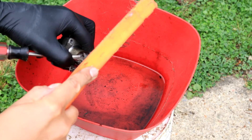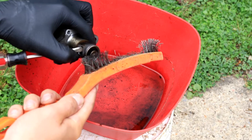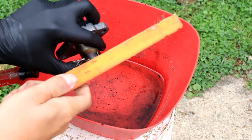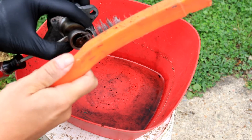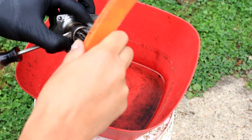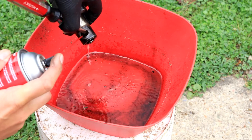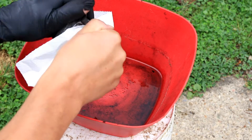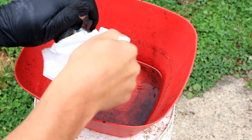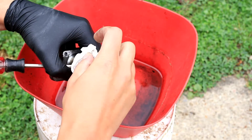If you use a screwdriver you can actually lift the little valve up just to make sure that anything this valve seats on is completely clean of carbon deposits. I'm not really too worried about scratching anything — this is all hardened steel so a normal wire brush should be fine. If you have a brass wire brush, that would be even better. You can see it's starting to get a lot cleaner already. Once it's completely cleaned off with the wire brushes and carb cleaner, just go over it with a paper towel and wipe any residue off — you don't want any chunks of carbon to restrict that valve.